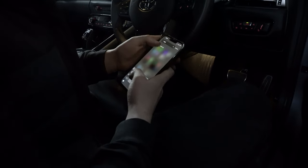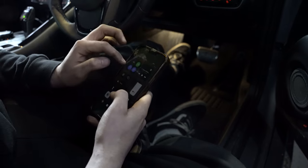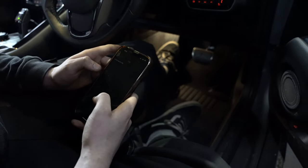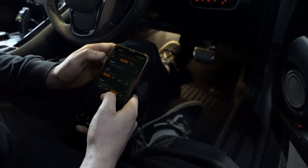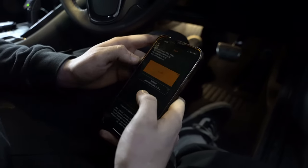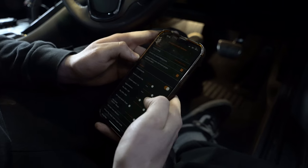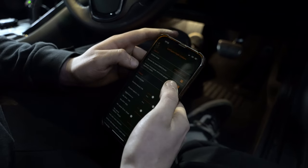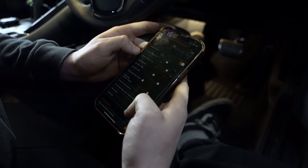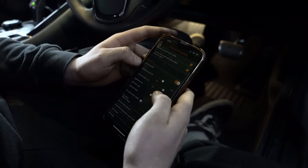We'll go MHD, F plus G. Tune, connect to Wi-Fi again. MHD dongle again. Stage two. Yeah, you can go 95 octane? No, one down, 93. So it's always start lower, then you do a log, and after the log, if there's no timing corrections, then you can go up. So increase, remove, cold start noise reduction on, start up on, OPF delete on.